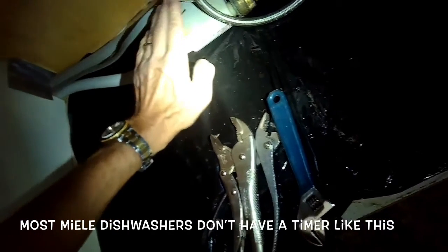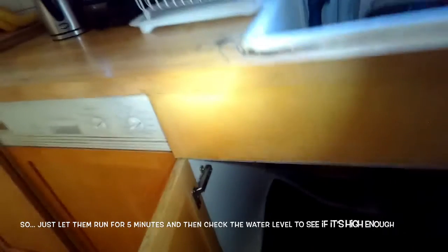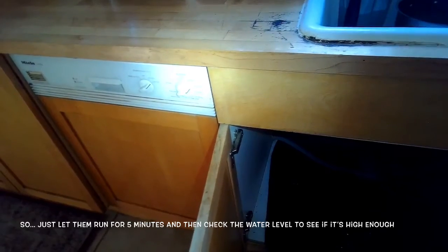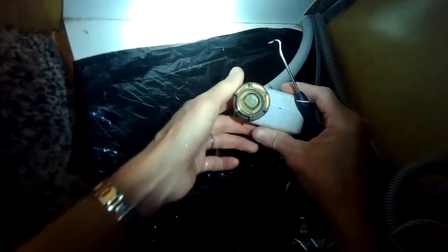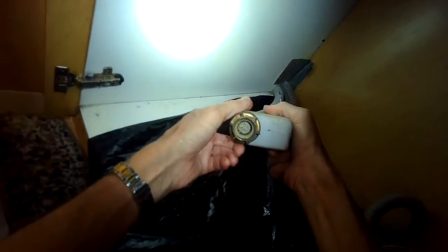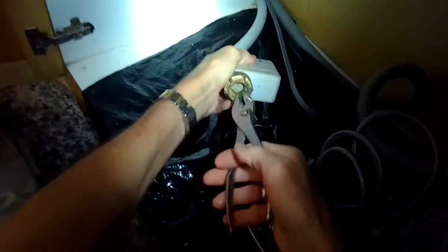So we got a vibration when it's supposed to fill. That's good. That means it's getting power, but maybe it's clogged. So let's go over how to clean that filter. It's pretty easy, just take you a few minutes. So first thing would be make sure you unplug it and you turn off the water, and then you're going to undo the brass piece here on the top, and then we're going to pull out that rubber gasket, and then we'll take a pair of pliers and we're going to pull out this filter right here in the middle. There's a little thing you can grab onto.